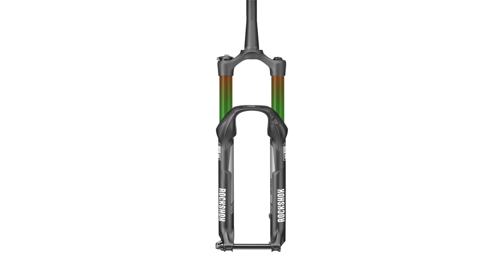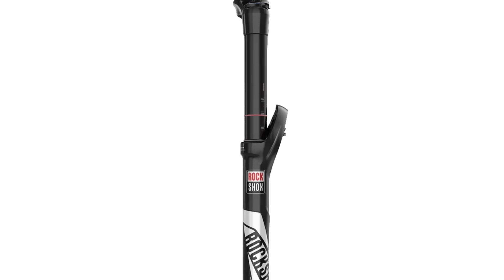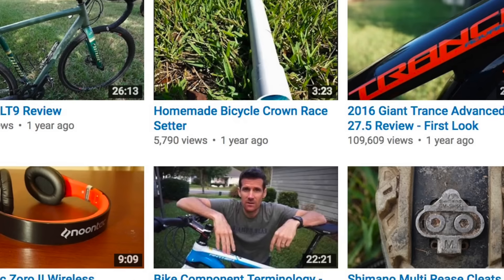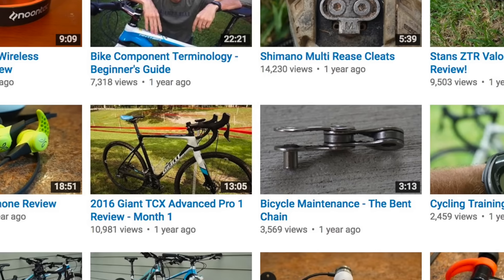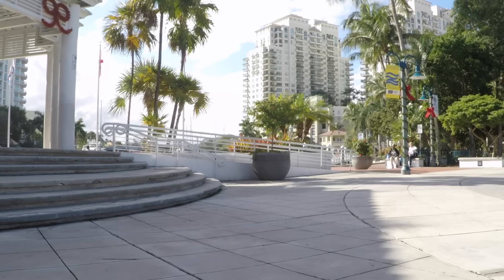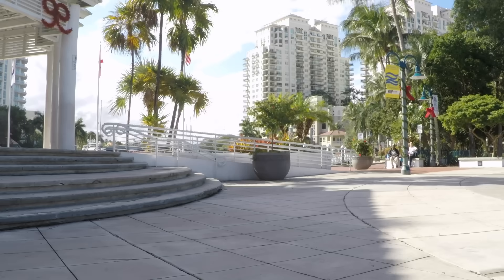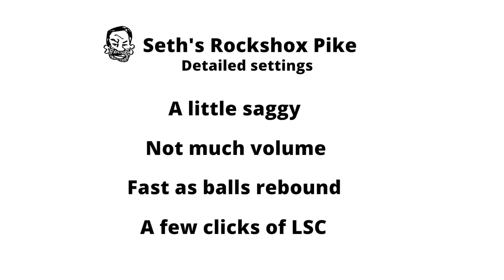So there you have it. My goal was to explain these settings without giving you information overload, but I know a lot of you like to get into more detail. For that, you might want to check out Clint's channel — he does long-form discussions on XC, cyclocross, geometry, you name it. I left some links to his videos in the description, as well as some charts, articles, and parts you can use to adjust your suspension. One thing to mention: you can apply most everything we discussed today to your rear shock. For all the beginners asking about my Pike settings — average sag, low volume, fast rebound, and very little low-speed compression.